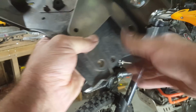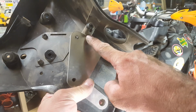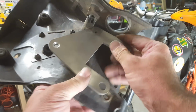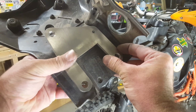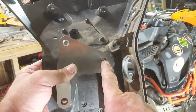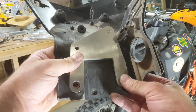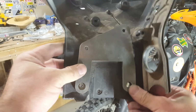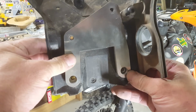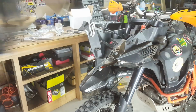Make sure you've got this up the right way. So your 2 spigot holes, this is against the plastic pin there. Hole's going to be drilled down here. If you put it in upside down, what's going to happen? Yeah, you could still do that. You could drill a hole there. That will be wrong. You'll have a wasted hole. So make sure you do that. You can see the light through there. All good. You got that one clear. That is the most difficult step, I believe.